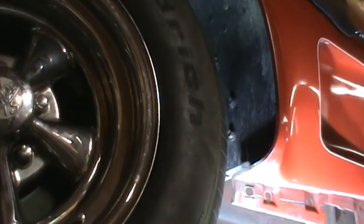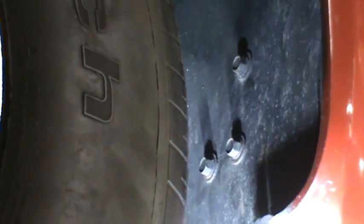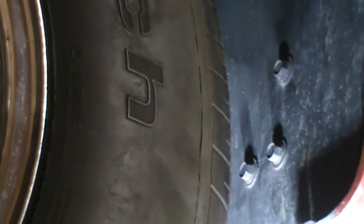Over on the driver's side there's a vapor canister held on by three bolts - you can see two of them, they're half-inch. There's the third. I'm just going to see if I can make quick work of them with the air ratchet and get that canister out of the way to proceed to remove the body mount bolt.